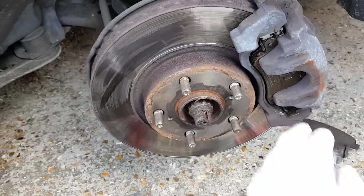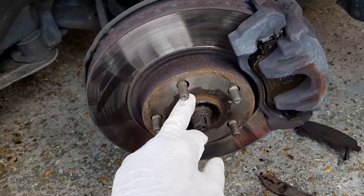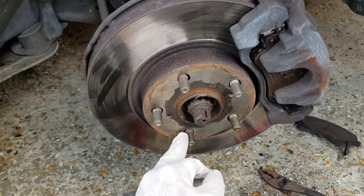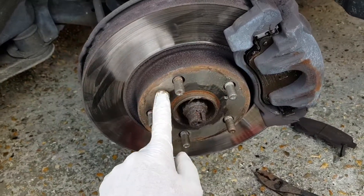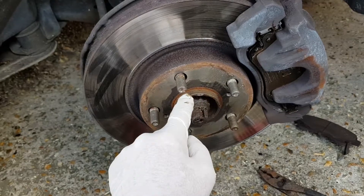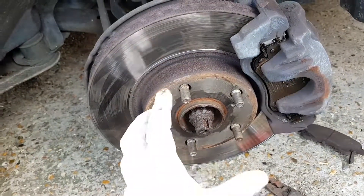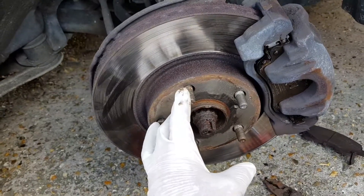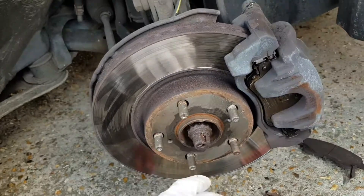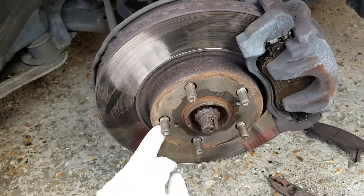Here's a little tip for you: while you've got the copper grease out and you've painted the back of the brake pads with it for lubrication, just put a bit of copper grease on the studs where the wheel bolts go on, and also on this surface area here around the brake drum or brake disc, and on that lip there. Sometimes you'll find the wheel, when it's been on there quite a long time, can actually corrode itself together and it can be really hard if you're stuck on the side of the road with a flat tire trying to get it off. So a little bit of copper grease, a liberal coating all the way around on that lip.